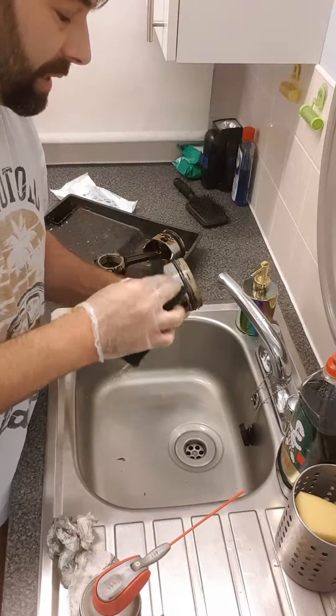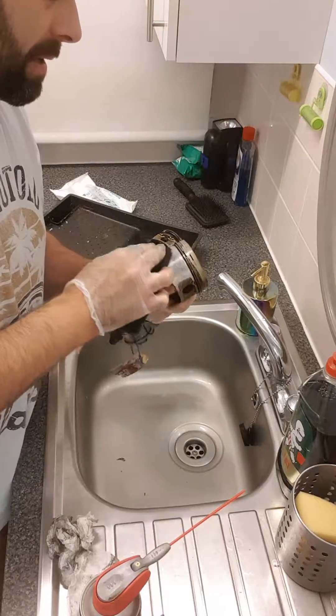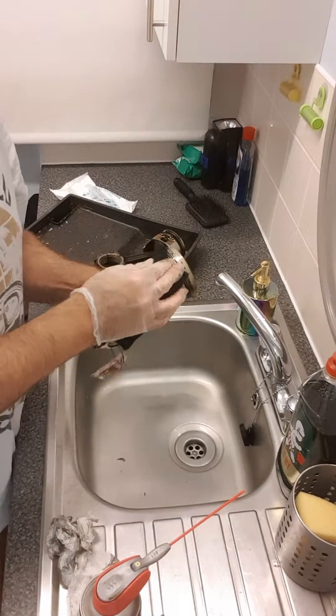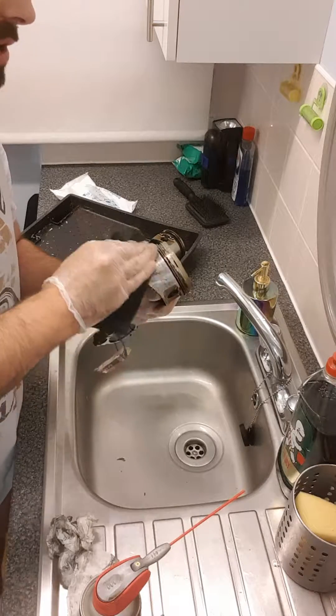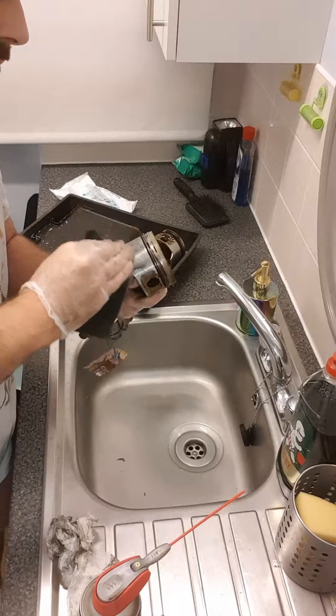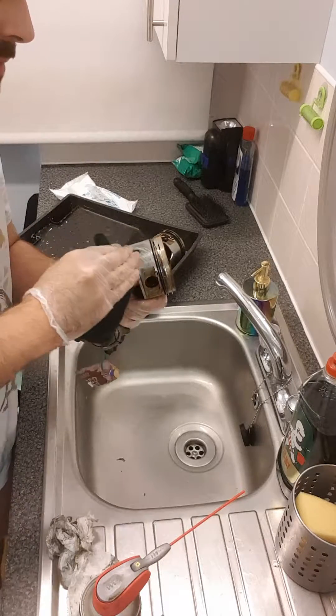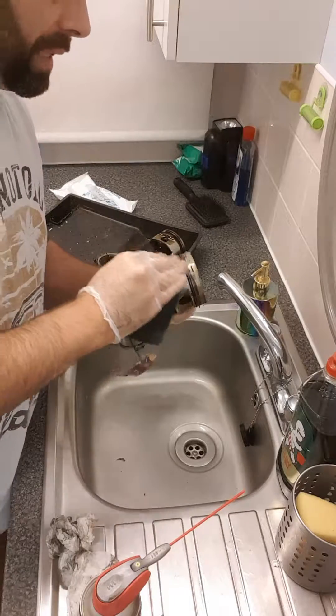As long as they're smooth, get standard pistons, measure your bores, make sure you are running a standard bore. If you're using cheap measuring equipment like me — because I haven't got much money — don't pay too much attention to it. The cylinder head is off with Race Developments in Gloucester, just going off for a skim, checking out the guides, porting and all that kind of thing.